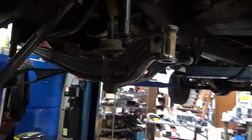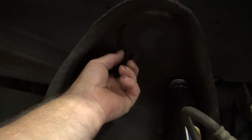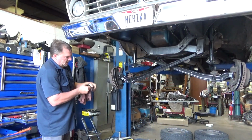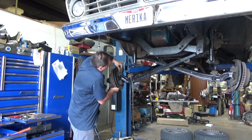So now I'm going to get my spindles off of my old arms and put those on, and then we'll put our steering on, and then I have to make some new straps, because these straps that hold the spring in are broken on both sides. So I'll have to make something for that. And then we can hopefully set this thing on the ground and move it around. Yay! Moving forward. Progress. The old kingpins actually look pretty good, so we're going to reuse them. Bushings.